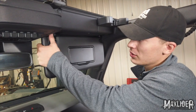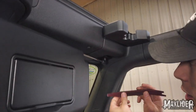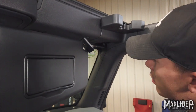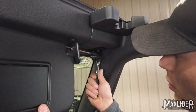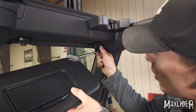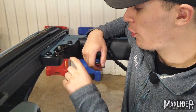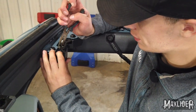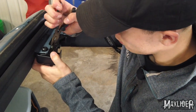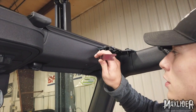With our wiring done and our light bar assembled, we are ready to get the truck ready for the light bar. First step is going to be removing our passenger sun visor — we'll move that out of the way so we've got room to work. There's a plastic cover up here that covers a seven millimeter bolt; we'll pry that off with a plastic pry tool, careful not to break it. This actually hooks on, so you'll want to rotate it forward to unhook it from the plastic trim. Then there's a plug up here — unplug that. Use pliers to push the metal pins in from the top and that'll let you pull the piece off easier. Right where these two pieces separate is where we're going to get access underneath to run our wiring.